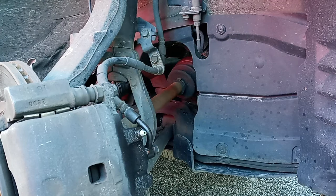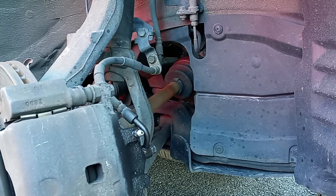So what I'm going to do now — I just did it two times. You don't need to do it too many times; you could do it about three times. I just did it twice because my brakes weren't that bad with a lot of air in them. And what you can do — if your brakes are really that bad — you want to do the rear the same way, both sides. But always do the front first, because eighty percent of braking is in the front at all times. So you want to get sharper brakes in the front first — eighty percent front, twenty percent rear.